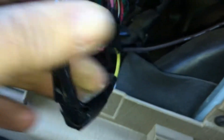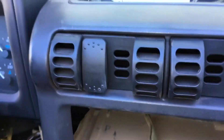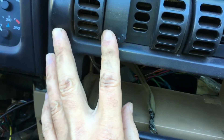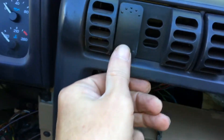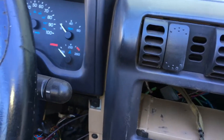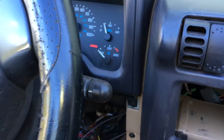Those two wires — I hooked up a 14-gauge wire to both of them, ran them up here, and put them into a toggle switch. On my Jeep I used a momentary toggle switch. Without the key it's in neutral — it turns over easy, no problem. If I want to start it I turn the key on. She starts up every time, no problems.